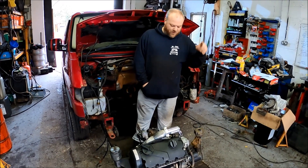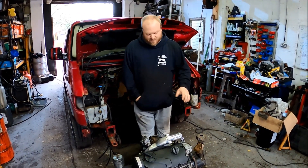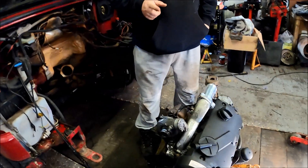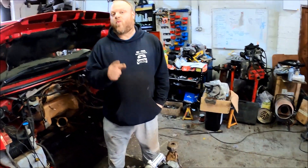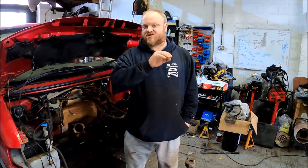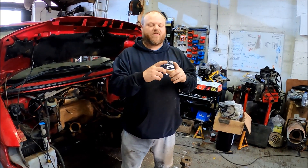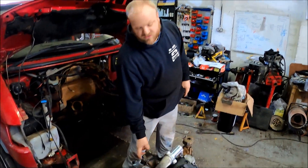We've got the inlet off of the Audi A4 and a KO3 turbo — not the original one. We've used the KO3 from an old 1.9 diesel Peugeot, not the HDI but the pre-HDI 1.9D or TD. They have quite big substantial turbos and can run quite a lot of boost. The turbo exhaust mounting flanges are both triangular and the bolts almost line up — all you have to do is redrill two bolts into the turbo housing and it will bolt to the manifold.